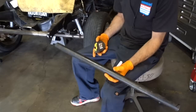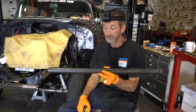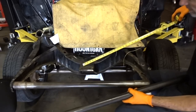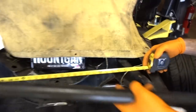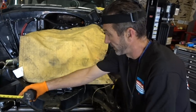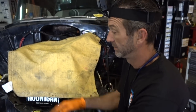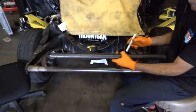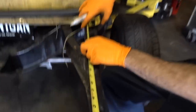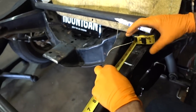It was stuff left over from our golf cart cage — probably stuff we're going to be using for the cage in this car. What we did is measure from right over those holes, frame rail to frame rail, and I cut it at 31 and a quarter. I cut it long on purpose. These frame rails don't go straight at each end — you're not going to be able to slide a straight bar into 45-degree frame rails. So leaving a little meat on the bones is good in this case. Hopefully this is straight, and you can go back and make a mark at around 14, then do the same mark.